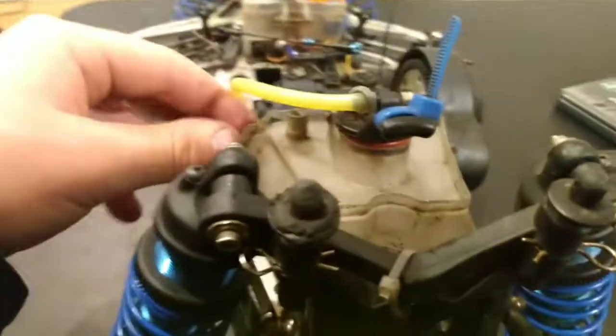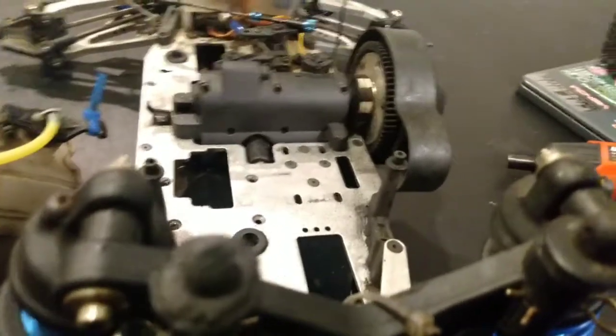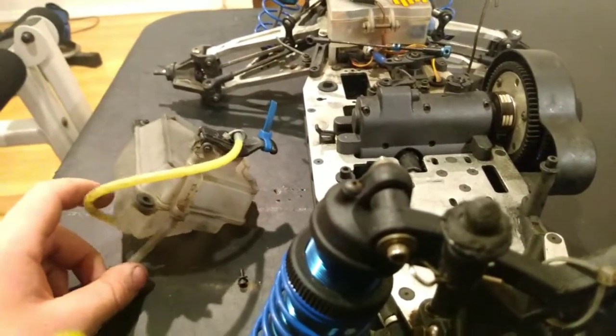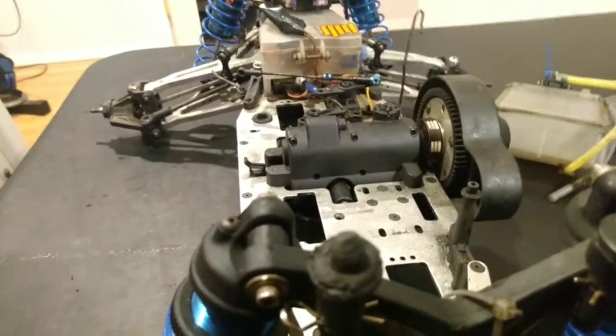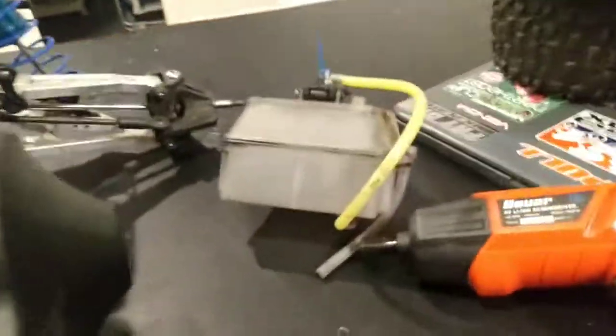So, this fuel tank is not that dirty, and it's very clean inside, actually. In fact, I don't run fuel filters on my tanks, even though they don't have an inline fuel filter. Not saying that you shouldn't, but from my experience, when I had one in here, it clogged up the line and there were air bubbles leaking in. I had one on my RS4 too and it was giving me issues, air bubbles in the line. So I got rid of them and it's fine. I haven't had any issues with sand going through the fuel lines or anything like that. Neither has my father. The only fuel filter that we run on my dad's Afna is not the clunker ones, but the fuel filter inside the actual tank.